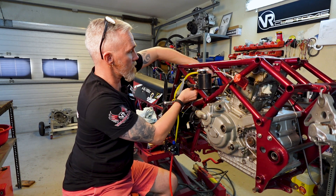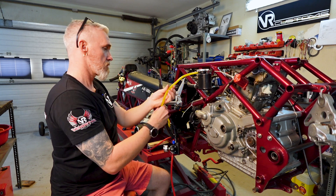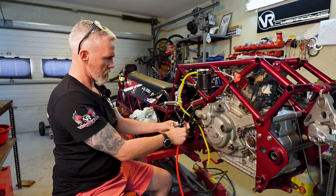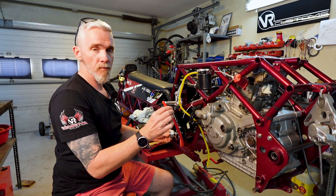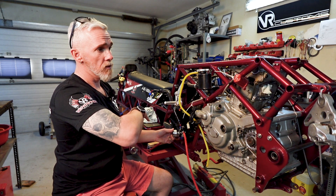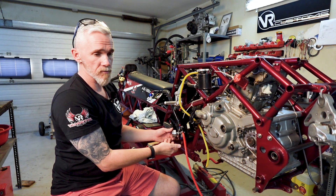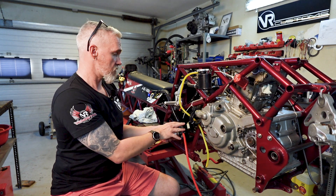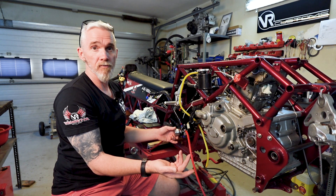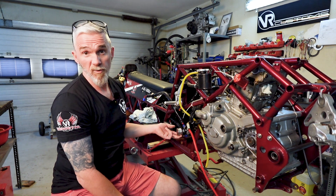And then from there, we need to get this fuel regulator sorted first, because that's just in the way. So this fuel regulator is a boost reference. There's a pipe on here that goes up to the manifold pressure. As boost is introduced into the plenum, the pressure rises, and the rising rate is measured here as well, so it actually creates more flow. It's sitting at around 40 psi standard, but when this thing's running full boost, you've got just over 60 psi of fuel pressure. The gauge is on there because there's a space for a gauge, so why not use it?